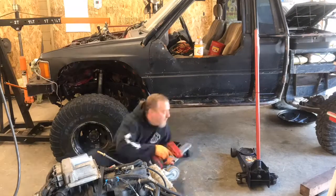If things really go well we'll put the clutch, flywheel, and pressure plate all back together in the truck. As you saw in the other video installing the motor, we can't install it with any of that stuff on there, so I'll do it all underneath. Then hopefully put the transmission in for the last time too, and then we can move forward on cooling system, fuel system, electrical, et cetera. Anyhow, enjoy the video — I'm just going to do time lapse since you've already seen me pull the motor out before.